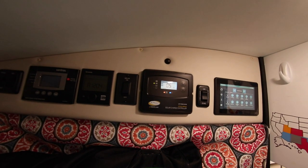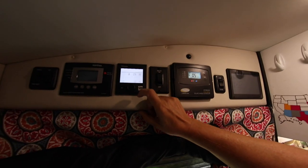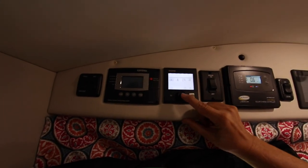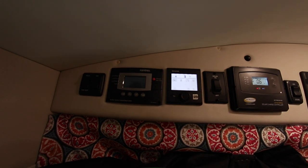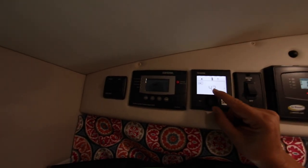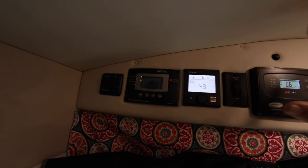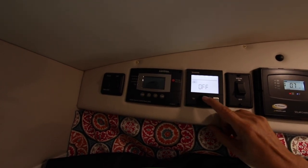This right here is the Truma. If you push it in, you'll see the little RV icon blinking — that means you've selected that one. If you roll it, it selects the different settings. If I press it in it says 'off' because the heater's off. If I turn it up and press it, it's going to heat the RV coach cabin. I don't like to heat it more than 62, because 62 is pretty warm. You can press it again and it's off.